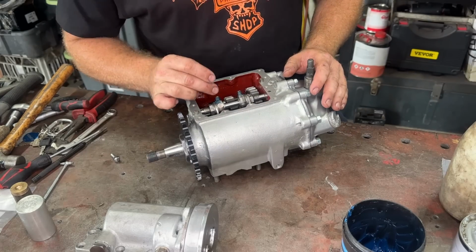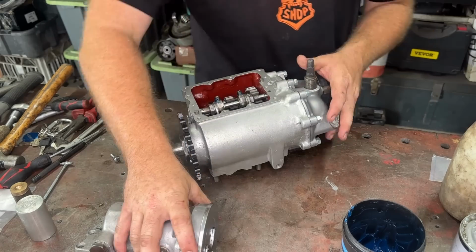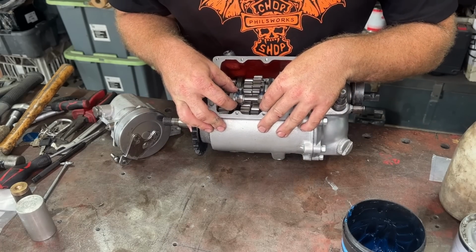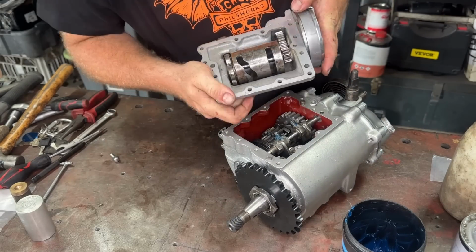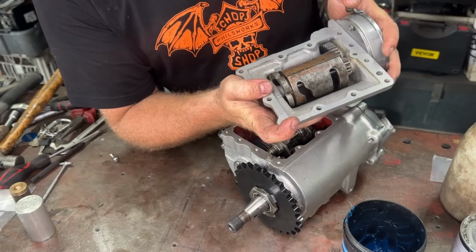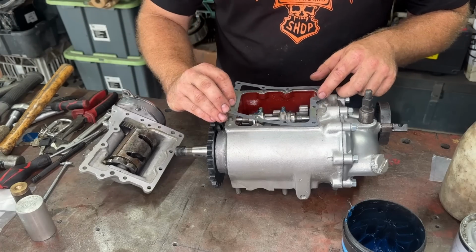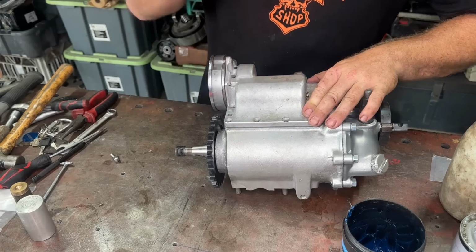So basically what you want to do, you want to grease up your little fork cup dog guys there, put them on, and then you just want to make sure your gearbox and your lid are both in neutral. To put your gearbox in neutral, you just put your dog between the 2 gears. So that is neutral there. And then on your gearbox, you've got to look at your little detent guy over here. So that is first, and you see on these little lobes here, there's a half lobe there. So that is neutral there. So you just want to move this till it's in neutral there. And then obviously, I'm not going to do this up because I'm going to time it, but I will just show you. So grease this before you put it together. He lives on there. And then this guy just pops on, just like that.